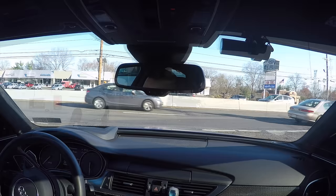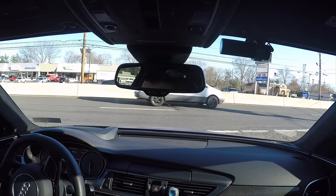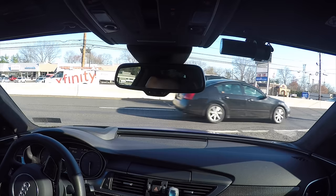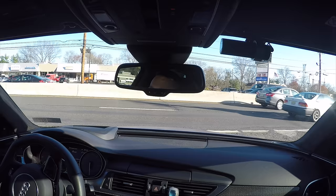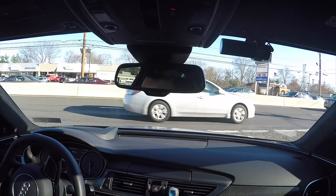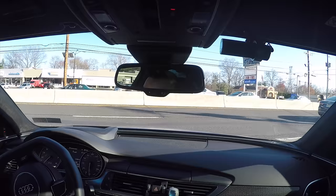Right now I'm driving in just regular mode. So in the beginning, I come to find out that the APR downpipes don't mate up to the AWE touring exhaust right from the get-go. The AWE exhaust actually comes up a little bit short by about 8 inches. So what they had to do was weld in about an 8-inch extension so that it reaches, which was no big deal. And it worked out. But that's what took a little bit longer.